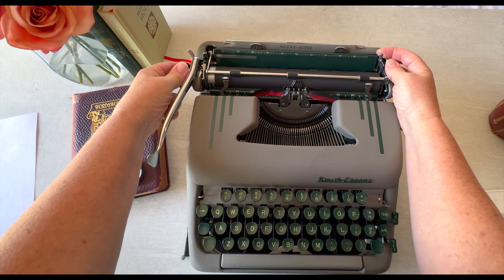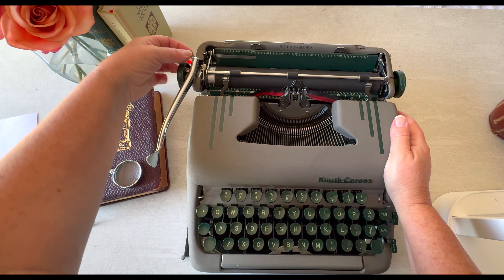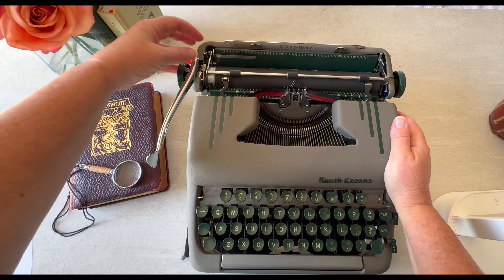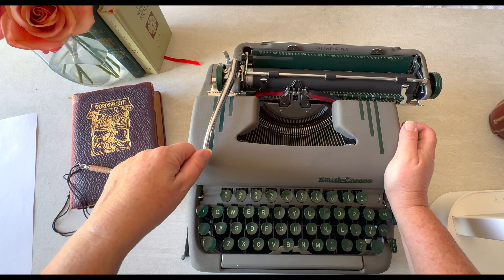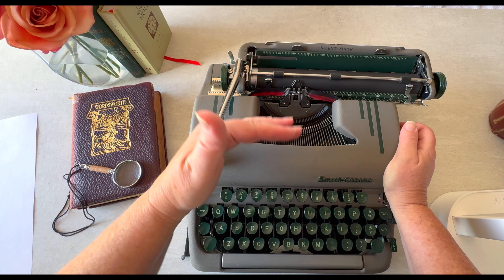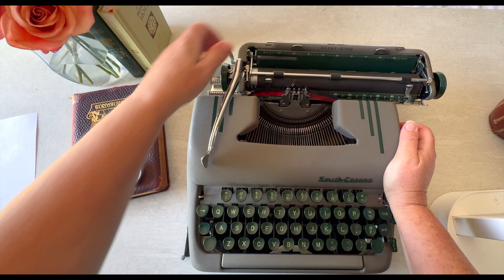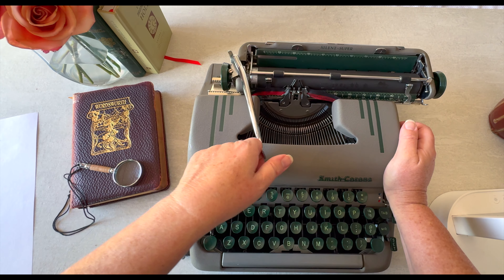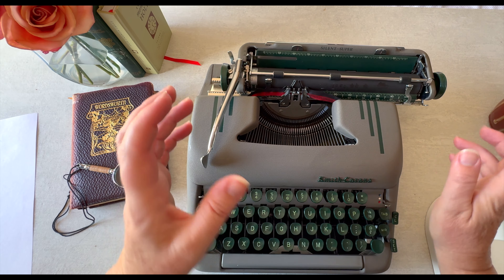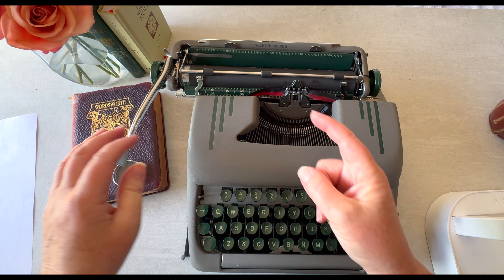On the right side is a paper release — you'll see more of that in a second. On the left side you'll see a one, two, and three in the back area by this lever. That is for your return handle. What it does is take you to the beginning of the line and advance to the next line. You can advance one, two, or three lines — so here's double spacing, here's triple — which is great if you want spacing between lines for editing, notes, or whatever you wish.